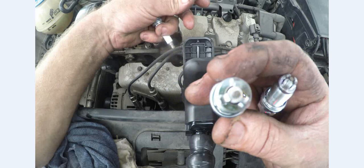But this is a very interesting spark plug. If you look at it, this spark plug basically has three earths. You have a centralized electrode which basically splits that spark three ways. So what's the advantage? You have a wider area that the spark plug is covering and that will burn your fuel and air mixture more efficiently.